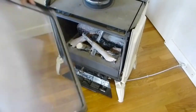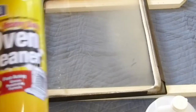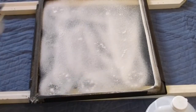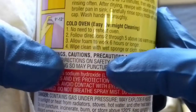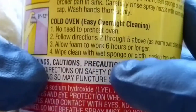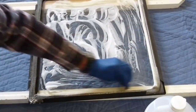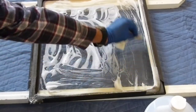What we're going to do is lay the dirty side up and begin with the oven cleaner — just shake it up real good and work it in a little bit. Make sure you get all the way out to the edges. It says for a cold surface to leave it on for six hours, but you'll probably get most of what you're going to get after an hour or two. When you wipe it off you're going to see a lot of the dirt come off.